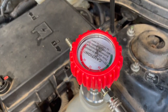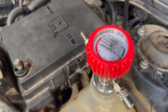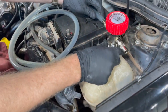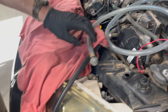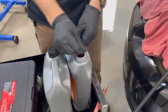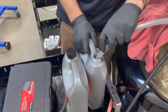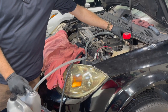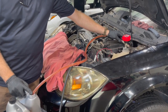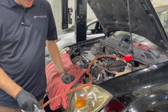Once our vacuum is stabilized, we know we don't have any leaks. We're going to attach the suction hose to that ball valve nipple. This has a little weighted screen on the bottom — that's going to go in our coolant jug. All we've got to do is put this in, make sure that it's held underwater, then open our valve and you'll see the coolant flow in under vacuum. You want to keep this submerged so it doesn't suck any air.